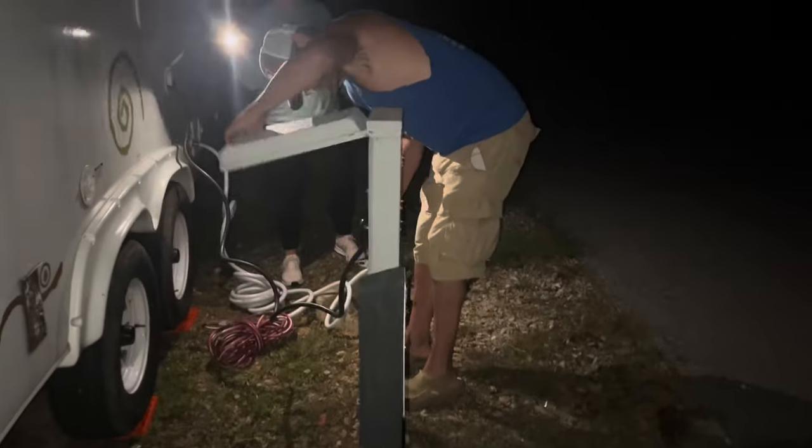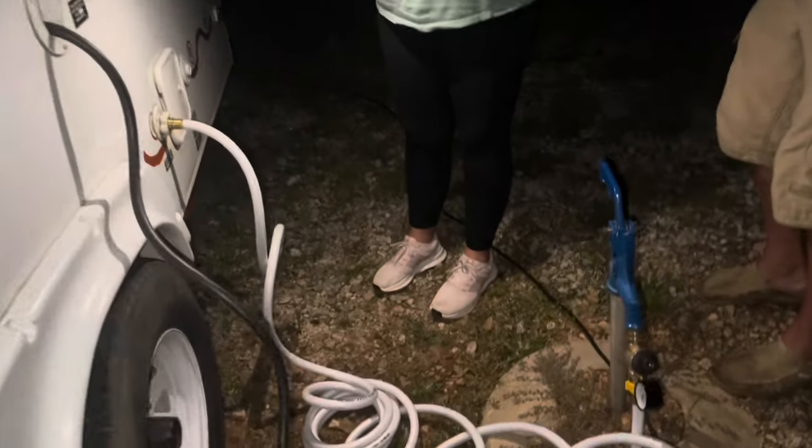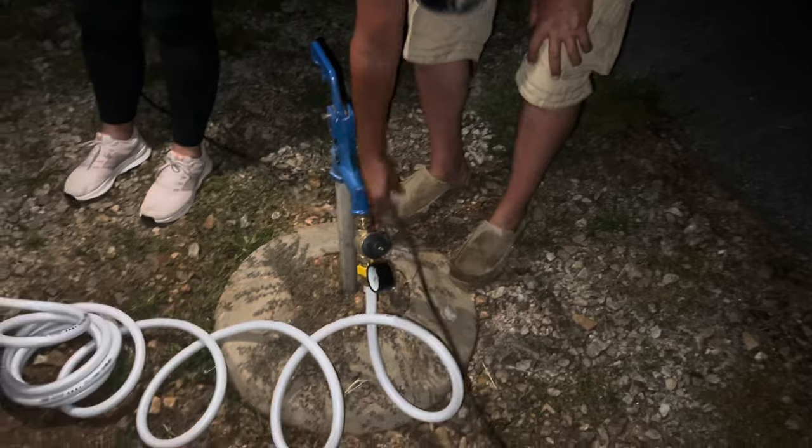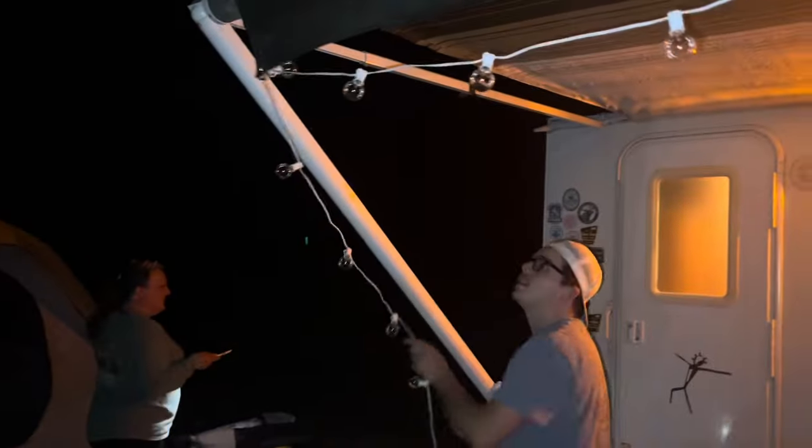And now we've got light — just disconnected from the truck. We're at the campsite. Just got done hooking up power. Breakers on. Camper's plugged in, water's on. Got a pressure regulator on there. We got the blocks underneath it, got it leveled up. This will be a YouTube video. Cody's putting his lights on his awning. I got the tent set up for Mom.